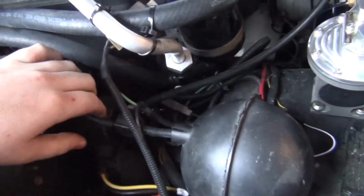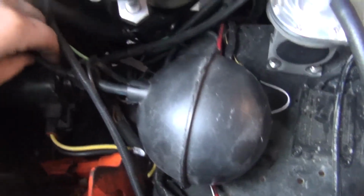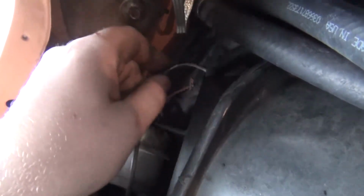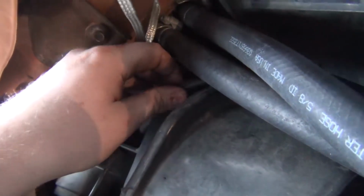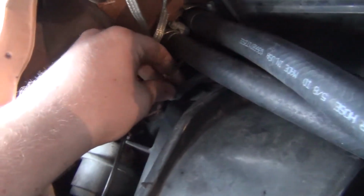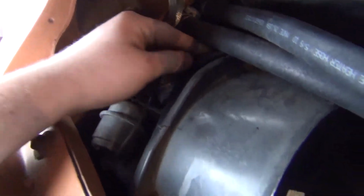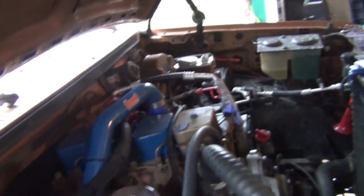And we just saw that the HVAC controls work great. They're more responsive than what they were before, and that's because I had fixed a vacuum leak a few months ago, and I'll show you where that was. You have all your vacuum stuff from the reservoir and whatnot. All comes into here. These little hoses here, well, there was two, or actually no, just the one, it was this one here. It was cracked, and so it was just leaking all the vacuum out. That's what killed my pump.